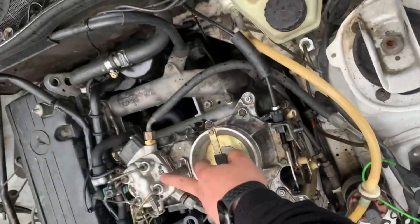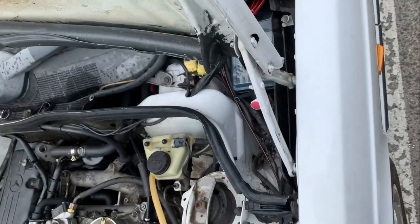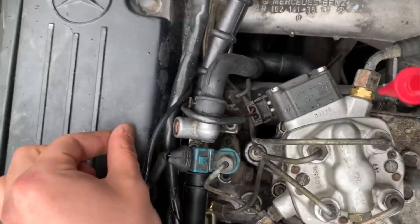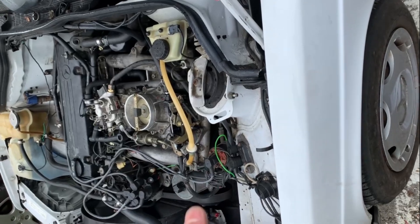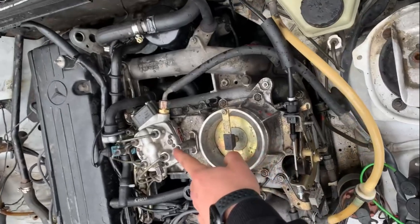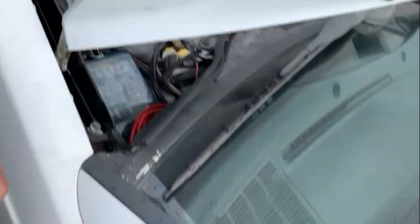What I did was crank it down without the multimeter — I know you said in your video nobody can do it by feel but it sounds really good now. I also have a manual idle control valve with a screw — screwing it in lowers the RPM, screwing it out increases it. When I turn it down the car gets really quiet, as you can see.